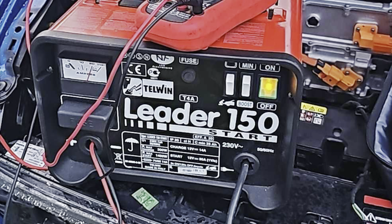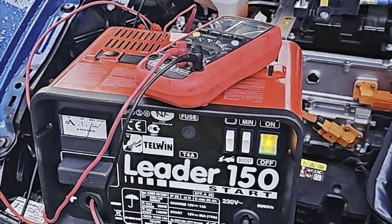So you can't just do that. Once you get that new 12-volt battery, you need to install an actual battery box — not a portable one. It has to be plugged into the wall and it must — this is a critical part — it must supply 20 amps or more to the battery in order to maintain the battery's charge at around 14 volts. This is boost mode, jump mode. A booster box will not work because the Fisker Ocean will drink it dry and you'll find yourself in another brick situation. If you don't have one of these, I'm going to post a link.